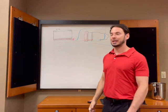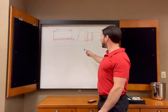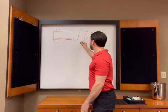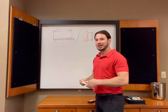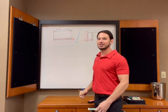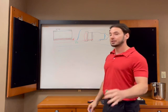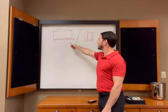Well, we're talking about Subaru in the 90s, in a very bad financial position. So they said, hey, let's just put a filter right here. Cool. So now we have this dinky little filter right in here. It looks almost like a fuel filter. And the point of that is, if we catch this clutch material, it can't clog that, we're golden. Whatever, man, I wasn't on the team that made that decision. The correct repair for that: torque converter replacement, fluid flush, radiator replacement.